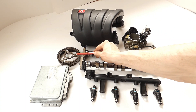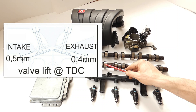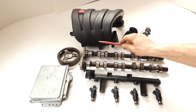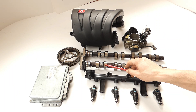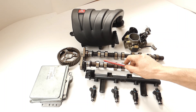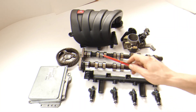For the lift at TDC, which we can set with the adjustable camshaft gear, I would recommend inlet side 0.5mm and exhaust side 0.4mm. That is completely sufficient. We get a better scavenging process of the cylinder, especially at high RPM. Don't overdo the overlap, since our camshaft overall has less opening time - everything we add in valve lift at TDC is essentially taken away from total opening time.